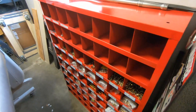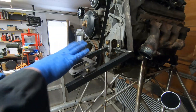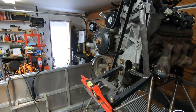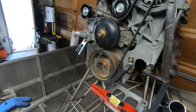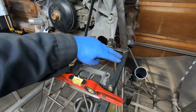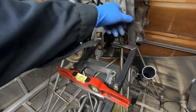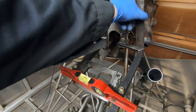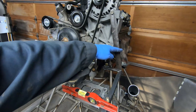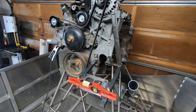So this is the plan now — the flange is here. I've got it pretty level because I want the turbo to be level once it's mounted. This is solid; I don't have the bolts tight yet on this one, but it'll be fairly solid. Then I'm adding this piece to triangulate it for a bit more strength, tying it into the alternator bolt. We'll try that.